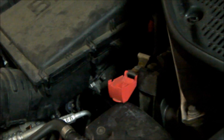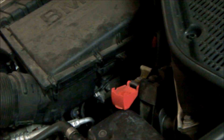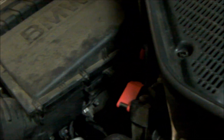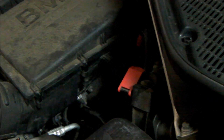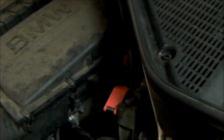When you pull the positive off at the battery in the hatch, you have 12 volts there, and the rest of the frame of the car is at ground because you've got this auxiliary battery hanging out at the front. After I got my new battery installed, I disconnected this backup battery, and it produced exactly the result I was interested in — not having to reprogram any memory stations, seat modules, or anything that had memory. Just pay extra special attention and have extra rags to keep those electrical circuits at the actual battery from touching anything they shouldn't touch.